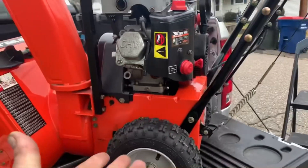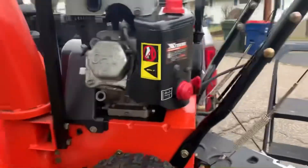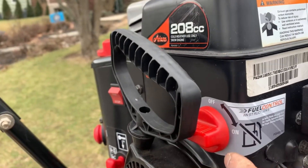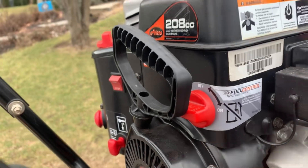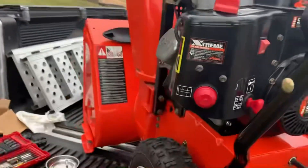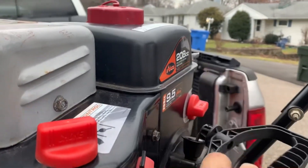There was a little bit of sediment — maybe it was just something on the needle. I had the thing running for 10 minutes, sitting for five minutes — no leaks. One thing I did notice though: these shutoff valves on the Ariens, at least they have a shutoff, but they don't seal well. I shut it off to drain the float bowl and it didn't shut off fully — it was still going drip, drip, drip.